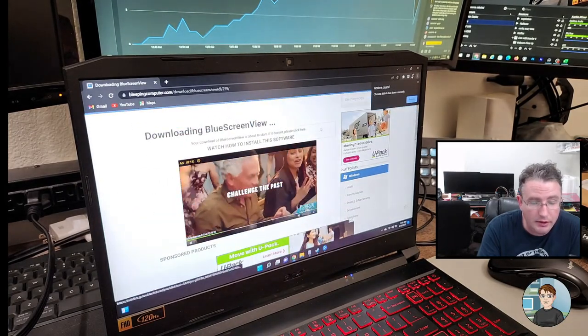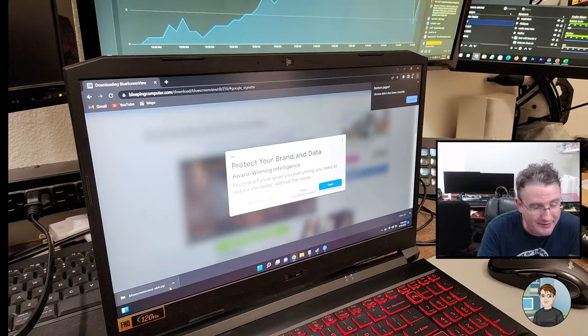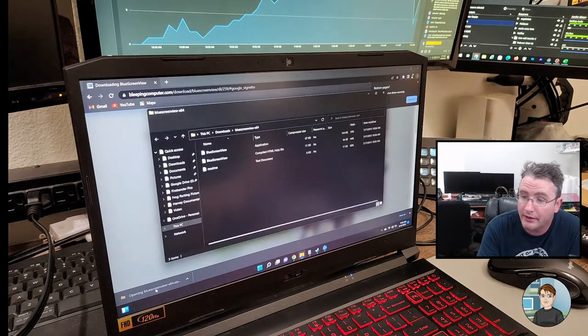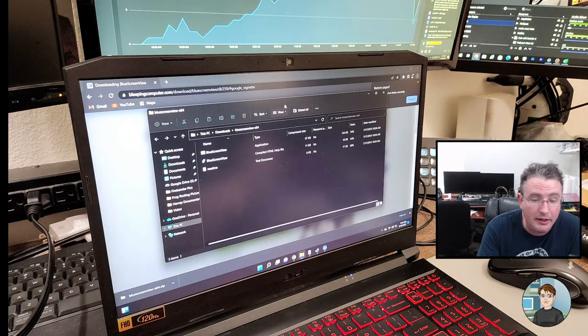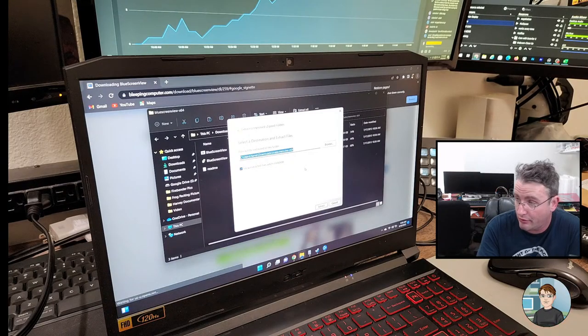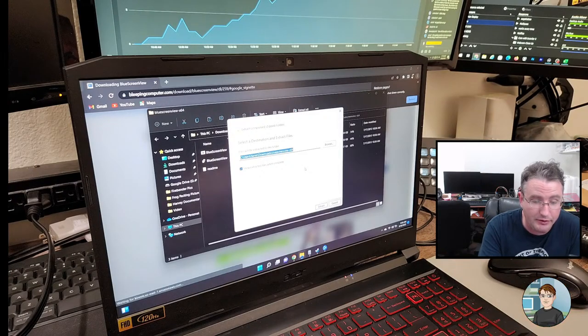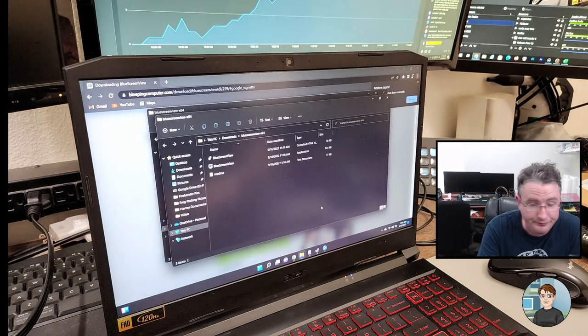Okay, let's get past the ad. Here it comes. Okay, so it's a zip file. I'm going to open it up and extract it, and we'll run it and try and point it at that file. All right, extract all. And by the way, you don't need an unzipping program in Windows, really any version of Windows for the last several years. It's built in. You highlight a zip file, and at the top there's options to extract it. No need for WinZip.